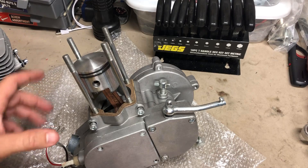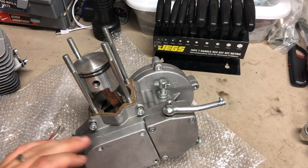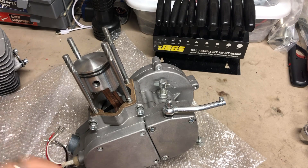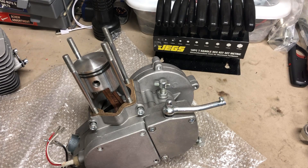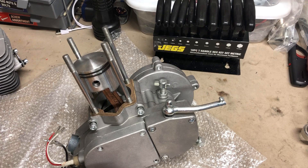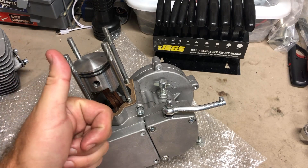You can also drop the sprocket from the stock 44 tooth down to a 32 or 36 tooth — in the low 30s you'll definitely get a little bit more top end, and you're not going to sacrifice that low-end torque because it's already there. The really only complication and hesitation toward this engine is that it won't be considered legal the way 80cc's typically are. In some stricter precincts and counties where law enforcement is more stringent on the actual cc of the engine, you might not be able to get away with this one. But overall, if you can and you want to, I do suggest these. Thanks for watching — my name is Mark, Southern Custom CC, be sure to like and subscribe.